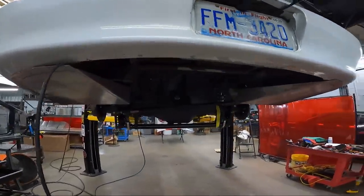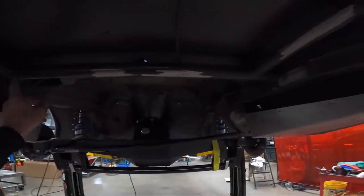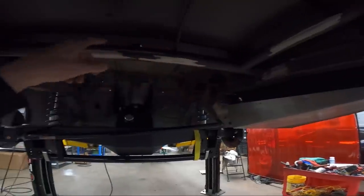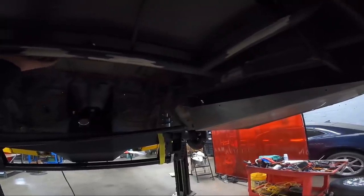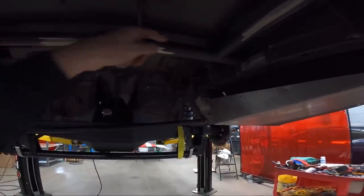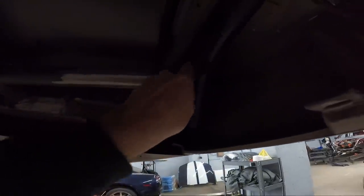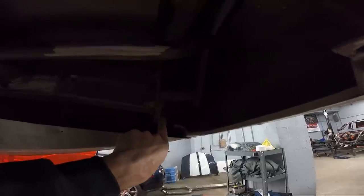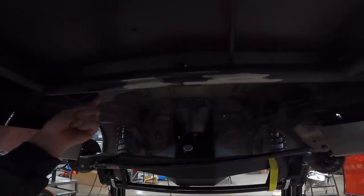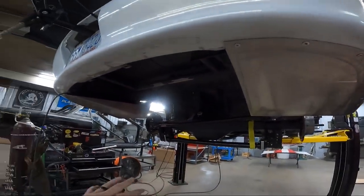When we did the setup on the 25.5 chassis back — I guess it's been a couple of years ago, maybe three — we did a big bar across the frame rails here to tie the C-pillars in right behind where the trunk kind of goes up. The C-pillars actually tie to a bar in the trunk, and then you've got other bars that go down from that mid-connection down to this bar. Either way, it's tied into the cage itself, tied into the frame rail here, plated, and tied back to the parachute mount — which is also still bolted to the end of the frame. So it's a big strong square, and this is convenient because we're going to tie the wishbone right into this bar.